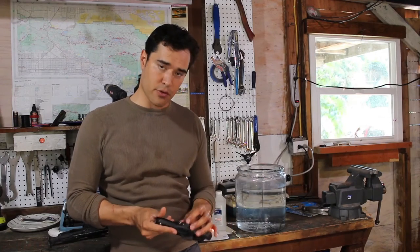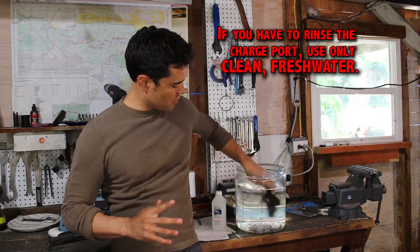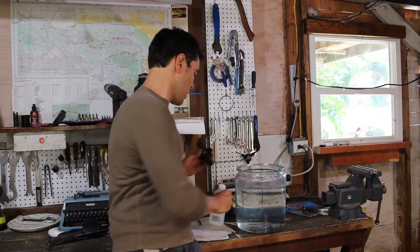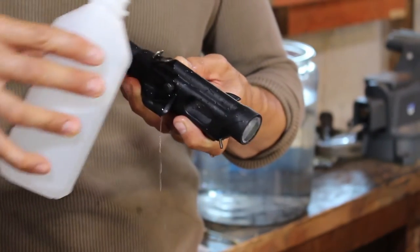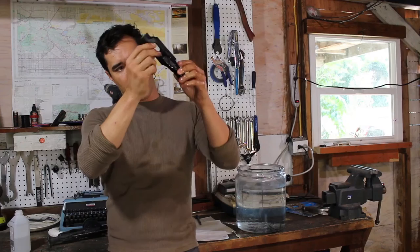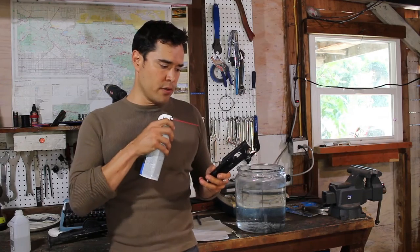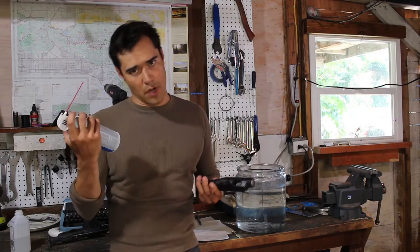All I would do is make sure that the screw is out and put it in a bucket of fresh water. Rinse it, swish it around — really make sure that little port is completely cleaned out. Shake it out. If you have any isopropyl rubbing alcohol, it's a great idea to hit it with a little bit of that. Shake it out, then let it dry. You can air dry it, turn it up outside and let it drip out. Or if you have some office air, you can use that to spray it out. If you use a shop compressor, make sure it's really clean and not spraying water vapor or oil — office air is always a safe bet.